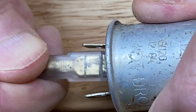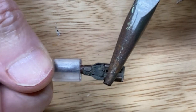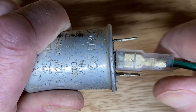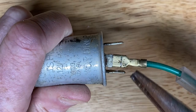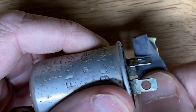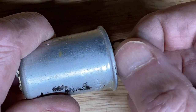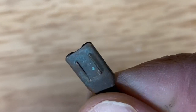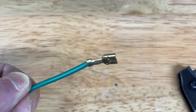You should be able to push the spade connector onto the blade by hand. If it's an old one and a bit loose, slide the cover back and nip it with a pair of pliers. But if there is any doubt, cut it off and replace it. You should be able to remove a spade connector by hand — grip the connector itself, don't pull on the wire. In the worst case, slide the cover off and pull it with pliers. If the blade is corroded, clean it with fine wet and dry paper, then give it a slight wipe with WD-40 — it won't affect the connection. If the spade itself is significantly corroded, snip it off and replace it. Properly done, this should only shorten the wire by four or five millimetres.